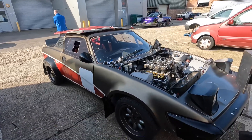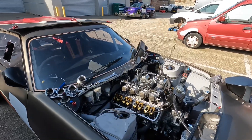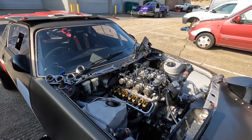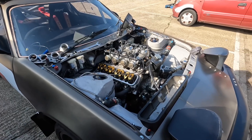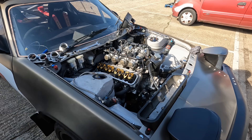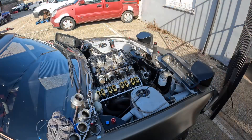That's his rally car, all custom built by Alistair and Boxy Body Shop, and then that's the V8 we built the other week. It was on the rolling road this week and the power figures weren't exactly what he was hoping for. I actually think the Australian heads are too big. I'm going to run through the tappets, he'll take it on the rally, and then we've got to find more power — maybe take another chunk off the cylinder head and a bit more off the inlet manifold to get the compression up.